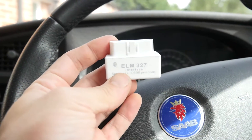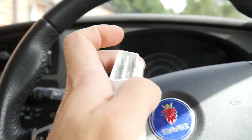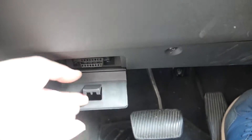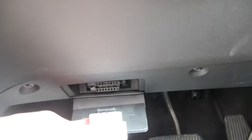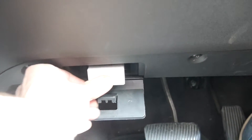Right, we're in the car. The dongle has been extracted from its bag. You can see it's a kind of a big D shape, so you can't put it in wrong. First thing to do is find the place in your car where you need to install it — in my car it's actually under the steering wheel, it generally is. If it's not under the steering wheel it might be under your ashtray in the centre console. Just slip that in there and it'll clip home.